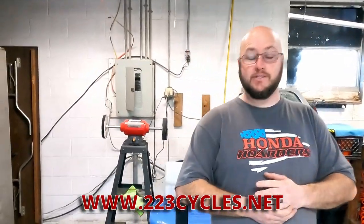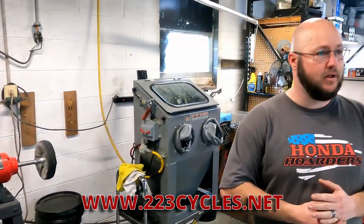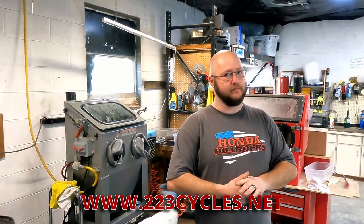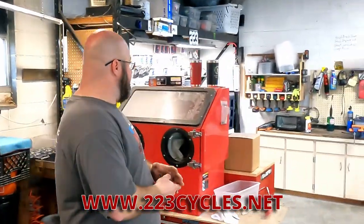Powder coating and a lot of the polishing, will be plating. Doing all the plating, just like so. That's a zinc plate. Is that correct? Zinc plate with yellow chromate, black chromate, blue chromate. So exactly how it came out of the factory. All right.